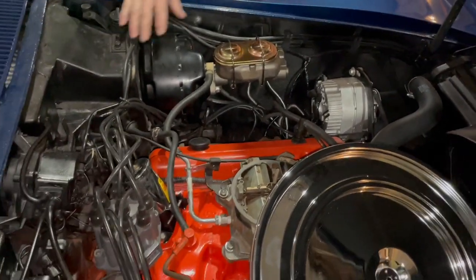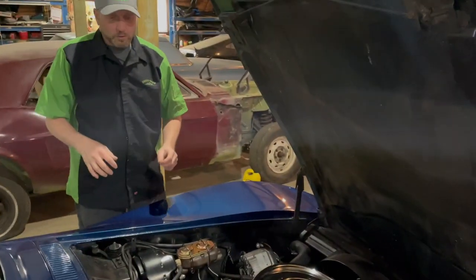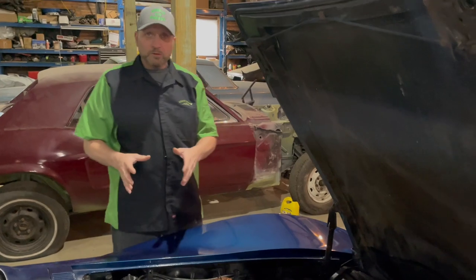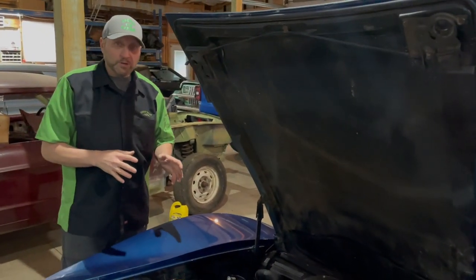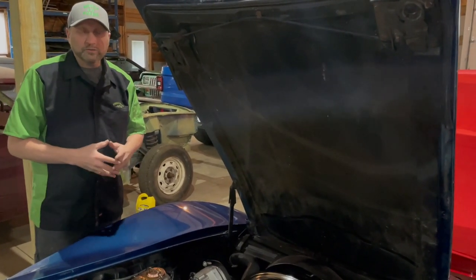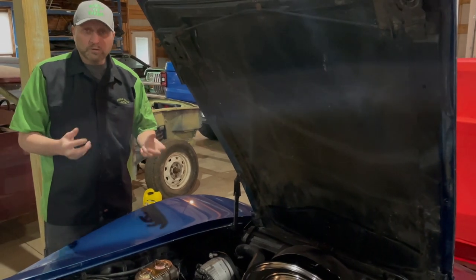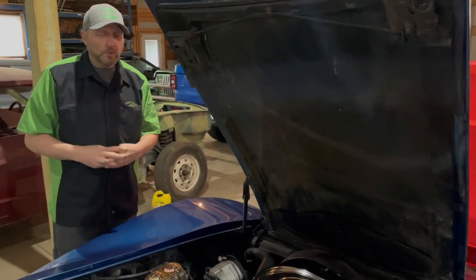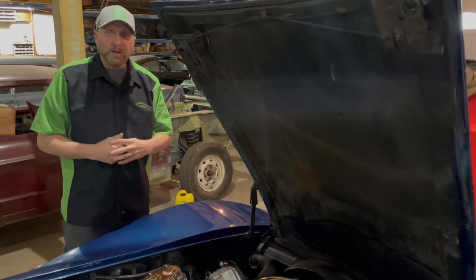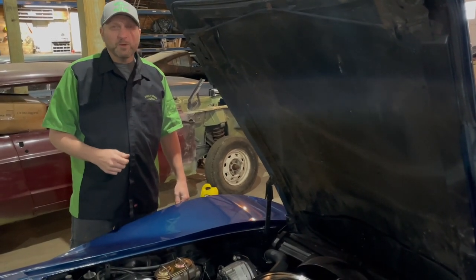Just finished installing the vacuum booster line. We trimmed the hose a little bit — that was the only thing in the kit we had to modify. Everything fits and looks factory OEM. The new booster and new master cylinder have both been bled and look like they came right off the showroom floor. We tested the car and it has great brake response now — much better than the manual brakes. Overall, two of us spent about five hours on this, maybe less the second time with the learning curve accounted for. We really hope this video helps you when installing the corvette brake booster power brake conversion. Don't forget to hit that like button and subscribe — thanks for watching Ghoul's Garage.